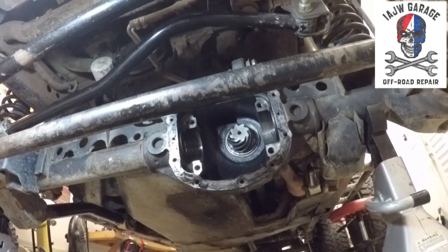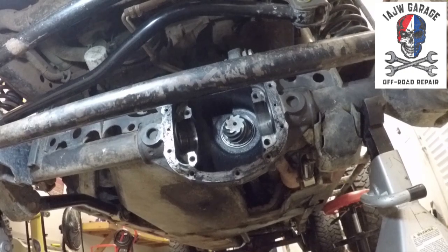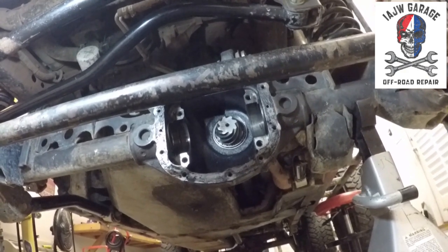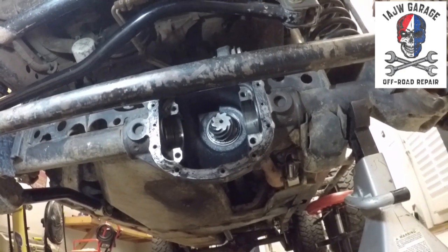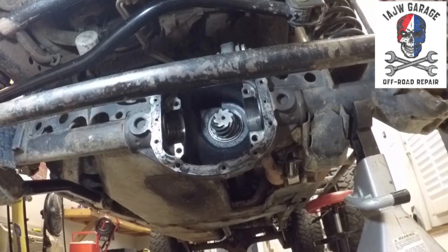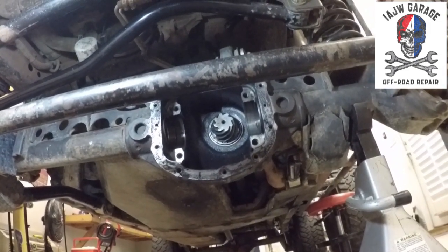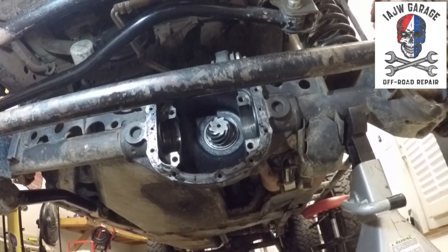Well, that just seems like a lot to me. I'll post all the information that I have under the video in the description, and you guys can do with it as you like. Me, I'm sticking with the 12 to 15 inch pounds on new bearings. I'm not going to go to 15 to 30. That just seems like a lot, even though the manufacturer may think it's appropriate. So now it's just clean up the surface prior to putting the carrier back in with the ring and locker, just so I don't get any garbage inside of it.